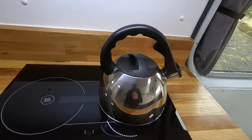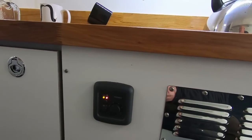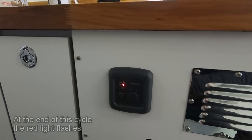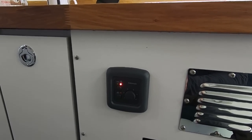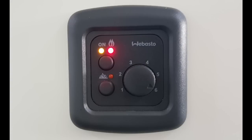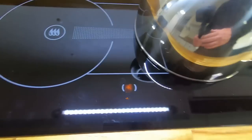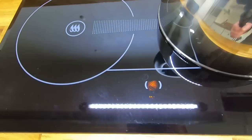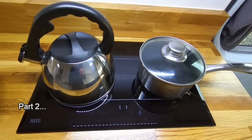Now I'll turn it all off, let it cool down, and repeat. When you turn this off, your light goes off and the red light will stay on for about five minutes as it goes through a shutdown cycle. This bottom switch on the controller is for use above 1500 meters — it changes the fuel mix — so I'm not needing it today. Even when the hob is switched off, the light on top showing it's hot stays on so you don't put anything on it. Once the hob warning light goes off, everything's back to cold.